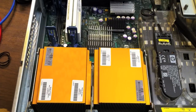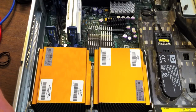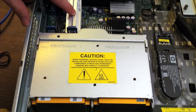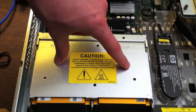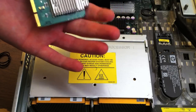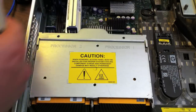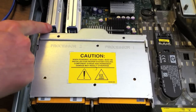I bought this additional heat sink online on eBay, just using the part number off of the other one, and I was hoping they would be pretty much identical — and they appear to be. I'm going to close that up and drop it down. One last thing: over here we have what's called a Voltage Regulator Module, or VRM, and this is a circuit board that provides power for the processor. Since our server only came with one processor, it only came with one VRM. I had to buy another VRM, which cost me about $10 on eBay — if you were to buy this from HP when this server came out, it would be $100 or more. You'll notice a notch in the corner — just line it up with the notch in the slot, drop it in, feel it click, and that's it.